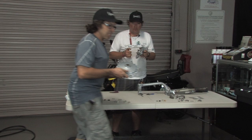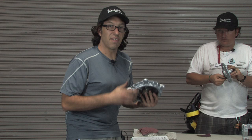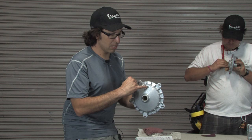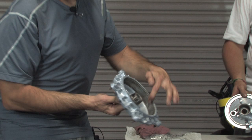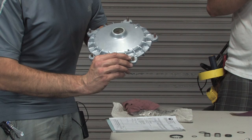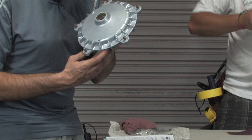The hub here — for some restorations we prep these and paint them with single stage paint. For this restoration we actually powder coated these parts. With powder coating you need to specify what you want masked, and remove all the rubber parts because they bake the finish on. Bearings are all tapped out. The steel cast-in liner and all the threaded bosses have been masked. One mistake: I would have left the tips of those threaded bosses exposed for powder coating — you can see they're a bit rusty. I'll touch those up with silver paint.